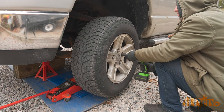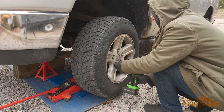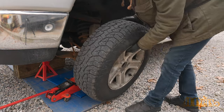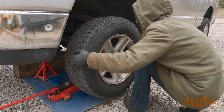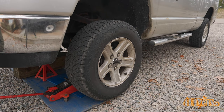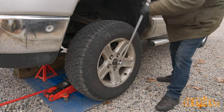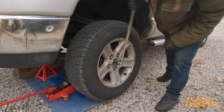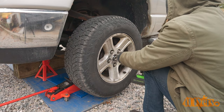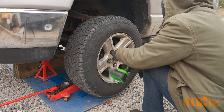Moving on to the opposite side for additional angles. Safely elevate the wheel and use a jack stand. Remove the wheel and then the center cap. Reinstall the wheel and tighten down the lug nuts, then lower the wheel back onto the ground. Using a 35mm socket with a Johnson bar, loosen the axle nut. Jack the vehicle back up and then remove the wheel.